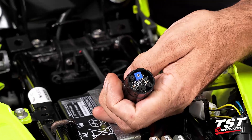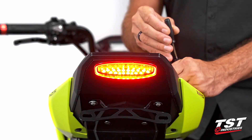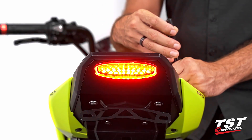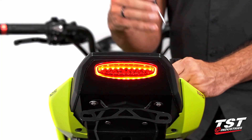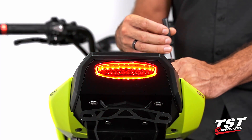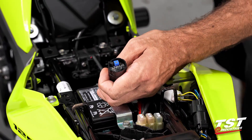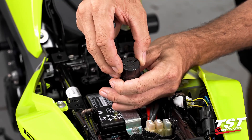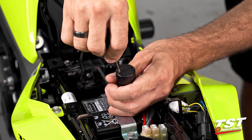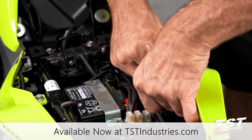In pulsar mode, it just keeps flashing continuously — I like to have it going pretty fast, but the choice is up to you. For intermittent pulsar, I find it belongs somewhere close to the top of the range to make it most visible, but again, the decision is yours. Once you're done with your adjustment and happy with all your modes and rates, replace the cap, turn the screws back in, and it really is just that simple. Replace your brake light modulator in the space you've decided to keep it, and you're good to go.